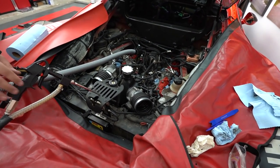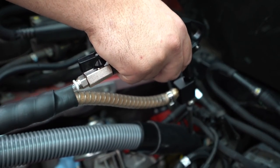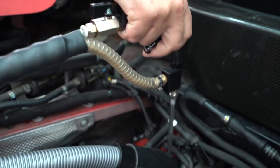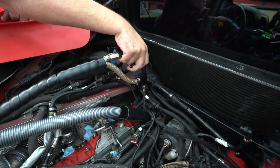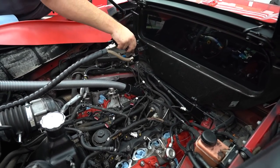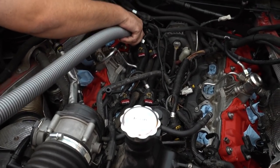Here is the valve prior to being walnut blasted — quite disgusting. We're going to take a plastic stick and scrape off the big chunks, because the walnut blasting doesn't seem to remove those by itself, but once we get the chunks out it will get it clean. Scrape it up, walnut blast it, and you'll see it's amazing. Make sure you move the wand around because there's gunk everywhere: high, low, right on the valve, up in the intake port. Then reach in and vacuum out as much as you can.